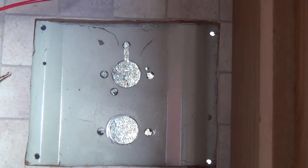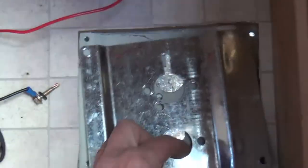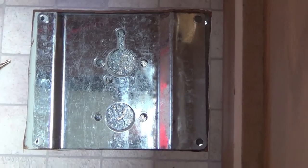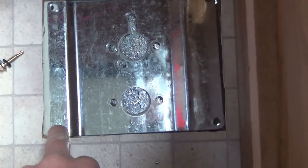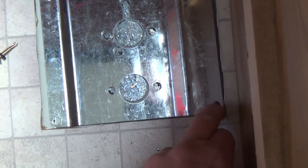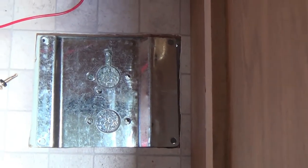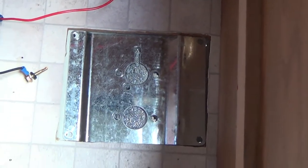So there was no way that was going to work. I had to cut the wooden floor and the lino out to get to the actual metal floor of the campervan itself, and then to cope with the up and down of the corrugations I've had to modify the fixing plate so that it actually sits down into that gap. It's now just a thin sandwich, so there should be plenty of room for both the pipes and the studs to go through so I can bolt the thing down properly.